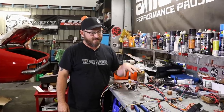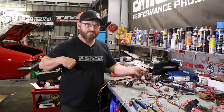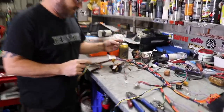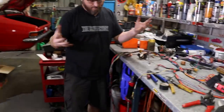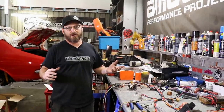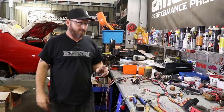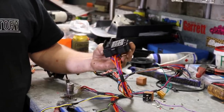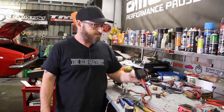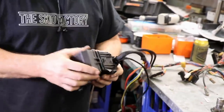It's mostly done now. What I've done is added the stuff we need to connect to the loom — that's just your ignition switch trigger and a brake switch. The rest of it is mainly fixing the loom because it's old. The headlight wiring was all melted and had bits of relays put in it — an absolute mess. I've removed all the original headlight stuff — it's still got that switch on the floor, but now all that does is trigger these relays. This is just an eBay-derived fuse box — I've used them heaps. One relay for high and one for low beam, with fuses for each side. I'm going to put a link in the description — recommended.